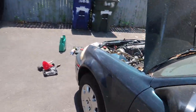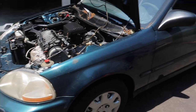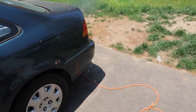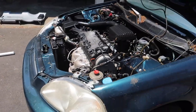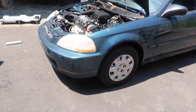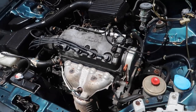I'm gonna rev it up, but the engine does sound a lot quieter — not gonna lie, it's noticeably quieter with the thicker oil and the oil additive, so that's helping at least a little bit. I'm gonna see if the smoke goes away entirely or down to the bare minimum. Then I'll turn it off, let it cool down, and crank it back up. If the smoke doesn't go away, I may or may not bother putting the kill switch in — but I might just do it to get it out of the way.